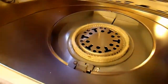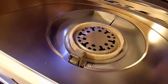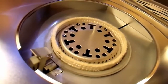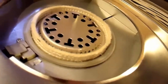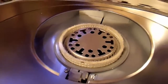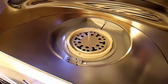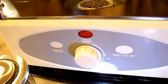I thought it was kind of interesting that you turn the wick up all the way and hit the igniter to light it. And they have this little igniter inside with a resistive element that contacts the wick right there. And they obviously tested this in the factory, because there's a little burn mark on the wick right where that igniter touches the wick, which is actually a good sign. I didn't expect them to even test something like this, a cheap consumer heater. But they did.